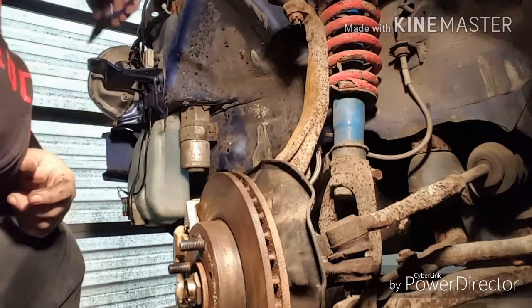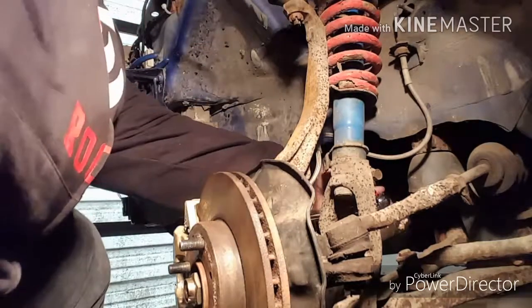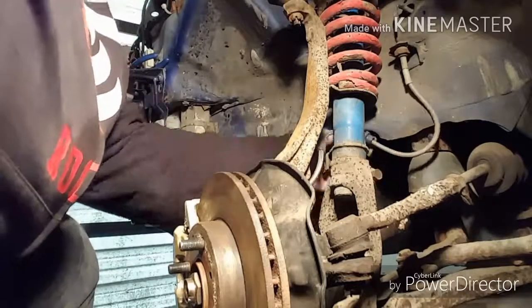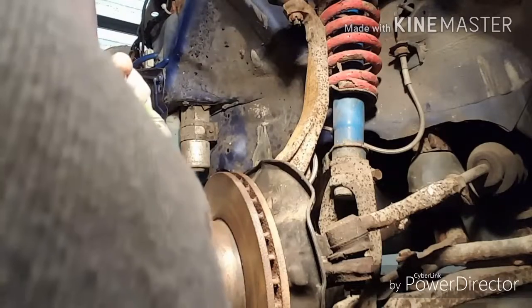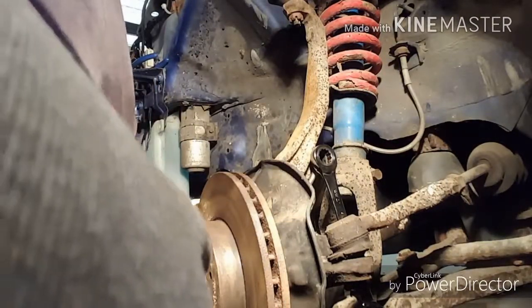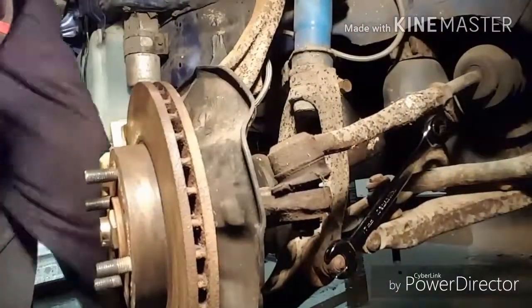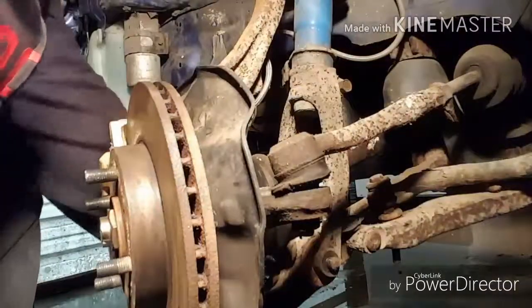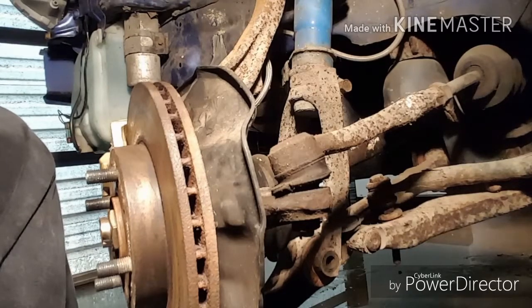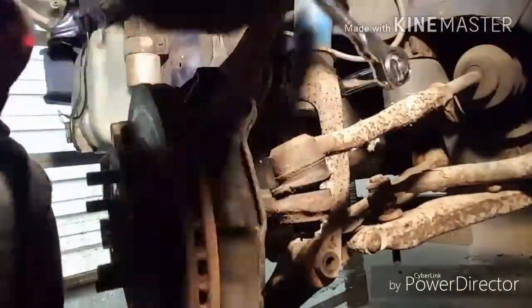Alright. Get started. First things first, I'm going to take the brake line bolt off before I forget it. Jump over to the 17 and the 17 wrench. Put that there. And take off the bottom fork bolt. Alright, I'm going to leave the bolt in there a little bit and switch to the 14 millimeter. That folds out.